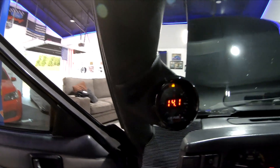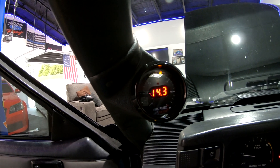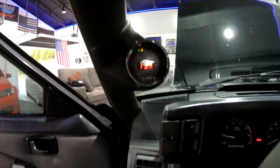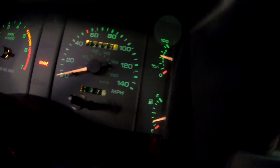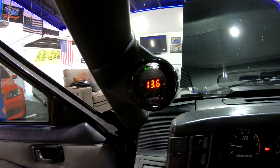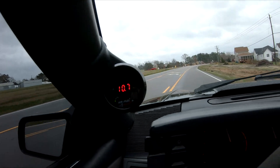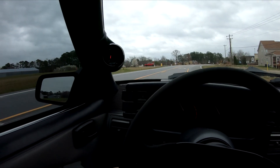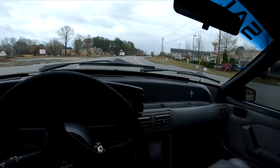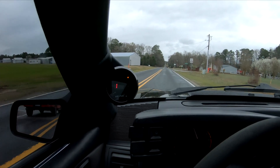It's starting to warm up. You can see from the sensor it's running rich — definitely richer than before by a full point. That's fine because we still have about a quarter tank of pump gas to run out. I'll drive it out rich, get rid of that gas, then put ethanol in, and you'll see the air-fuel actually go back up where it needs to be. Right away you can tell this new wideband sensor reads better than the old one — it actually goes richer like it should.